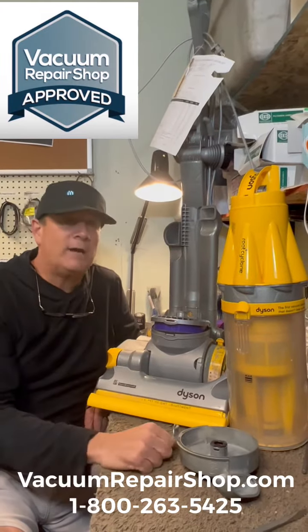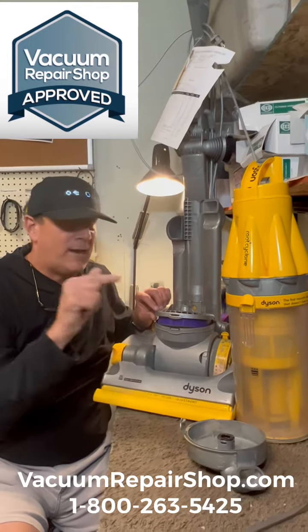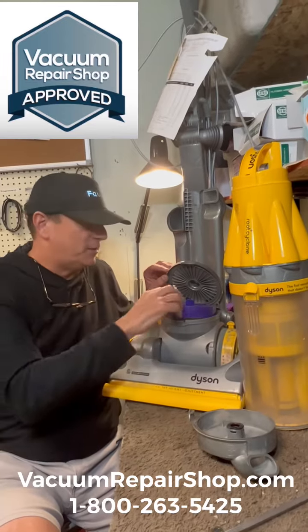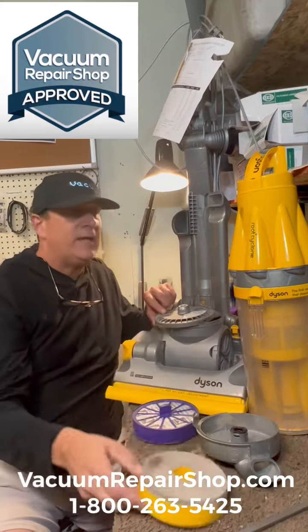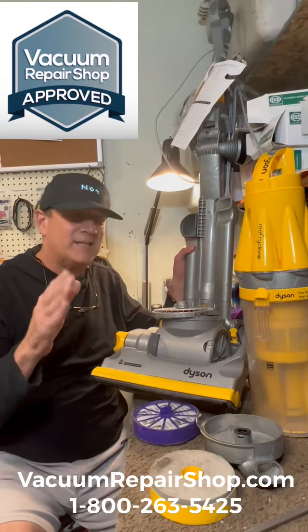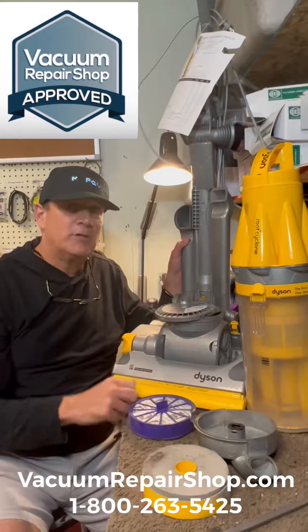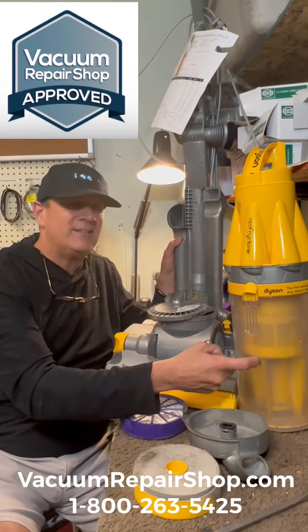But anyway, they do require some maintenance. You need to get your Dyson into the local vac shop no matter how well it's running and no matter how long you've had it — every couple years at least — to replace this HEPA filter, replace this washable filter over here, have the cyclones cleaned out, and also replace that brush on the bottom. If you want this to last a long time and clean at 100%, you really got to change those filters, change that brush, or think about trading this in, because just dumping the container is not a good idea.